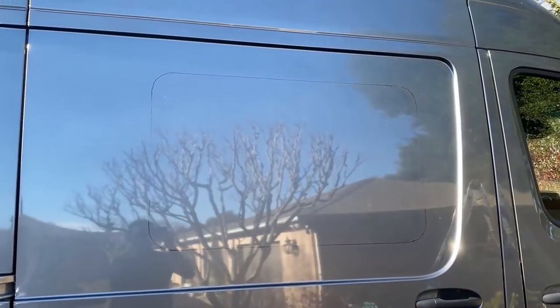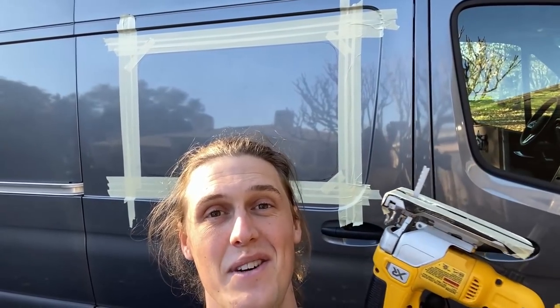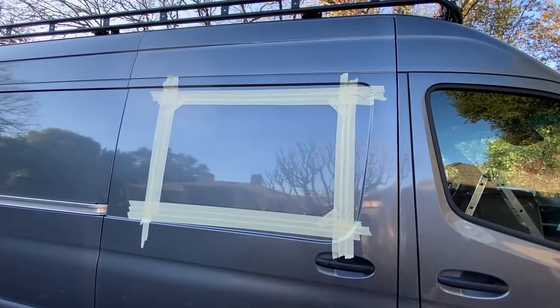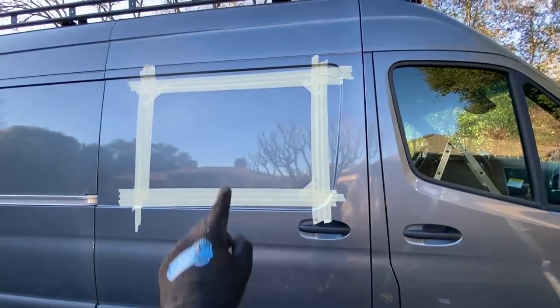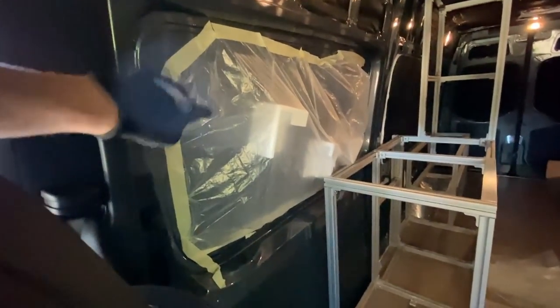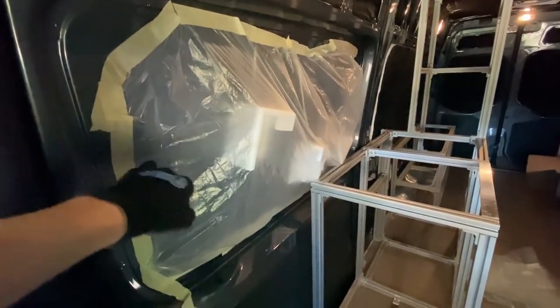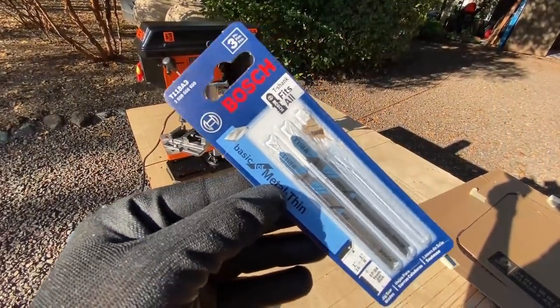We have a nice line to cut from. It is now time for the scariest part — cutting a hole in the side of the van with a jigsaw. We did a little prep: masking tape on the outside and on the bottom of the jigsaw to not scratch the paint. We've taped off the location to keep metal shrapnel from going inside the van or falling down into the wall. Foam blocks are there to keep things clear for the blade. We put in a fresh Bosch metal-cutting blade — link in the description.